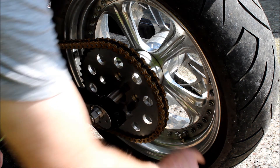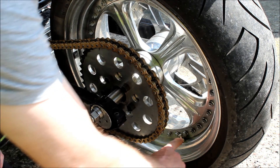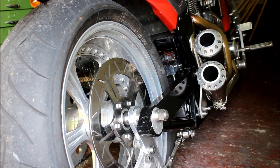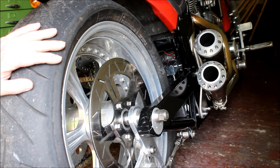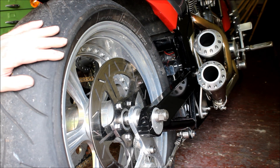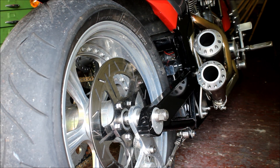It is actually strange stuff - it just reminds me of mint sauce for some reason, it's got little weird black bits in it. Anyway, here we are, a week later - or rather six days later - and I've just checked the tire pressure in this rear tire and it's still at 32 psi, so it's not going down at all, which is great news. It was going down maybe 1 or 2 psi a day, so it wasn't something that stopped me from riding the bike, but I'm happy now - I've fixed it. The Goop stuff has done what it says it should do, so we're all good. Thanks for watching and cheers.